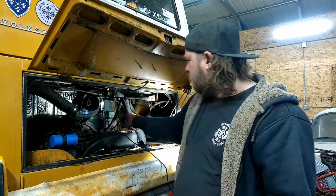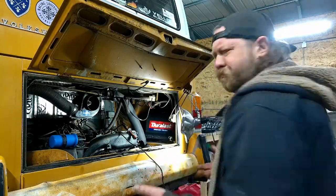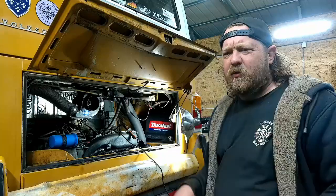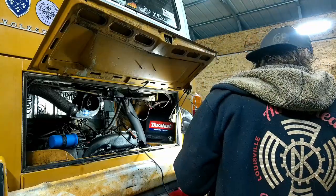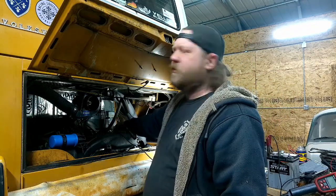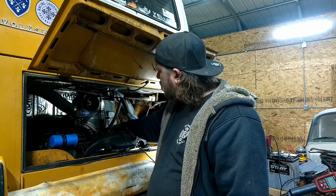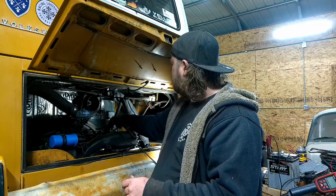So what I'm gonna do now is pull a plug and see what it looks like. I'm not hoping, but assuming it's gonna be rich, just on the way that it was, with the eyeballs burning. If it's rich, we know we have a carb issue, or it's just way out of tune. But I hate Pancakes because you can never find the spark plug on these things.